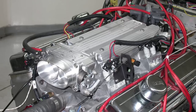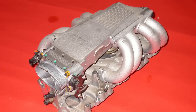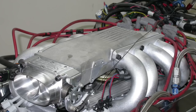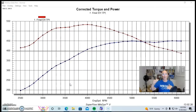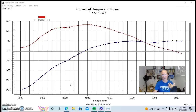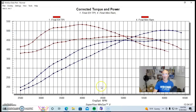Now let's see what happened when we tried different intake manifolds on our 383. We've looked at both our test motor and what happened when we upgraded from the stock TPI to the modified version with the ported lower manifold, extrude-honed big tubes, and the modified factory plenum with the bigger throttle body. Now let's illustrate what happens when we change the runner length — we're going to go to extremes, and then look at what happens when we go in between. Our longest runner version is the factory TPI stuff, modified for higher flow but the same runner length.